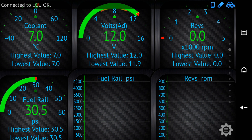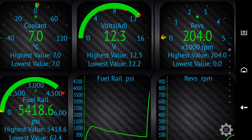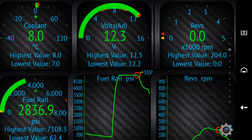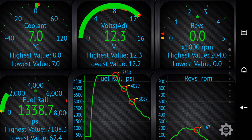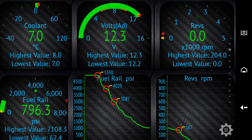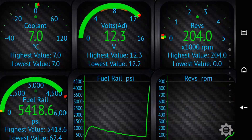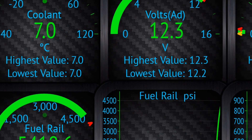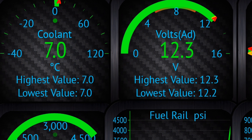I've got this non-start situation, so I'm just going to turn the engine over, capture some data, and then talk you through the sorts of things that you'll be looking for. So we've got the data captured. The battery voltage drop didn't record as I would have liked, but I'll explain why that's not that significant on this occasion. We'll start at the beginning, which is coolant temperature.